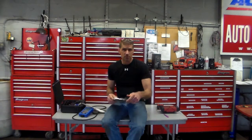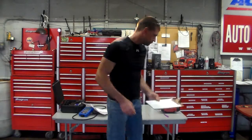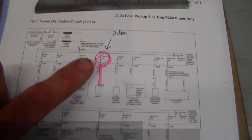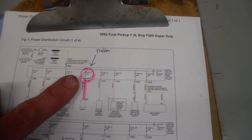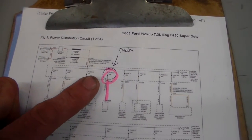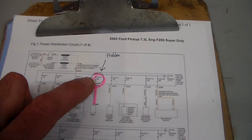At the time it was acting up, I saw the radio acting funny — very erratic. I thought that's a fairly simple circuit; let's check power and ground for the radio. Fuse 11 — 20 amp — goes right to the radio. That was my next check, and at that point I found voltage fluctuation from battery voltage down to zero when the problem was acting up. There was my power distribution problem right there at that fuse.